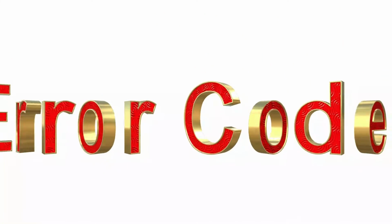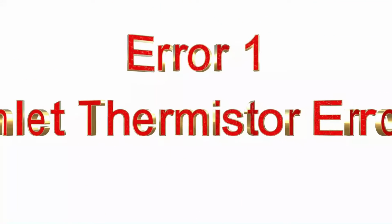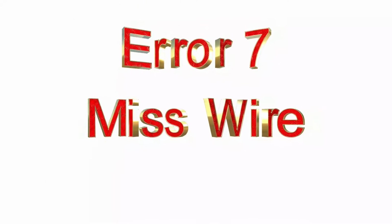So let's go over the error codes. Error code 1, inlet thermistor failure. This means that the thermistor reading is out of range. Error code 2, outlet thermistor error. Error code 6, stuck button. Error code 7, miswire. Error code 8, door latch stuck.